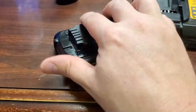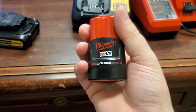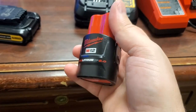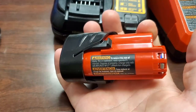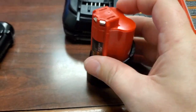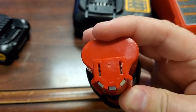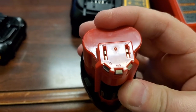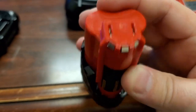We also have the M12 — the infamous little battery — this is a 2 amp-hour battery. You can see there are technically three cells in this one. It's also got several terminals: thermistor T, C1, C2, B-plus, and B-minus.